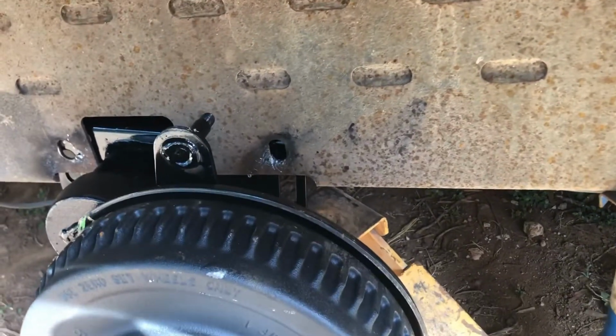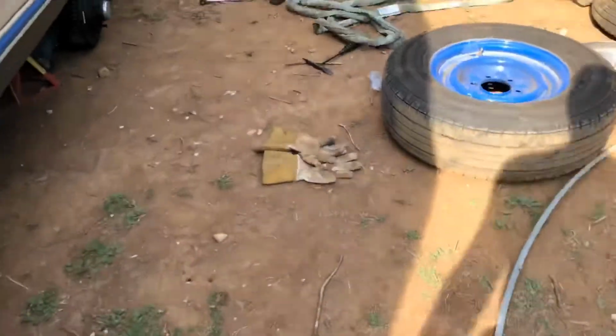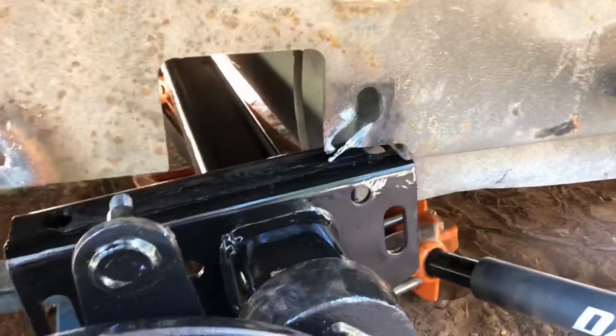Okay, and once you got the axle in there, to jack it up, I position one of the jack pads on the back of the flange that bolts to the frame on the axle tube. And then I put the other jack on the actual axle tube, about 2/3 of the way through. That way you get a little leverage on the other side if you need to maneuver it. And that kind of gives you control over all the axes of motion here. So I've got that other side sort of jacked up, so now I want to bring this one up. You'll see it won't try to rock back on me. I'm gonna do this with one hand. Anyway, so that's how I hold it up in place when I'm doing it by myself.